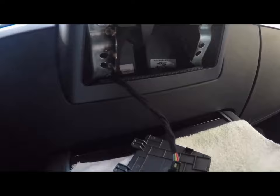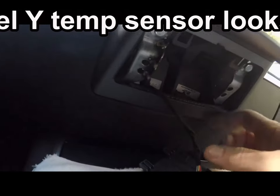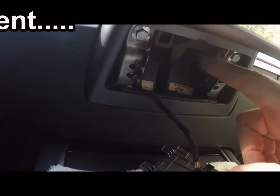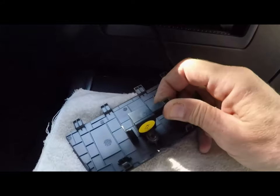Look up underneath the screen and you'll find an access door. There is the cabin temperature sensing probe, and there is a slot to pry that cover down. You'll notice the plastic on mine is marred — that's because I've taken this off a couple of times. Get a screwdriver that's a little on the sharp side, insert it in that gap, push up and turn to get it inside, pop that cover down, and then unplug the temperature sensor and set it aside.